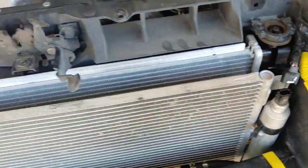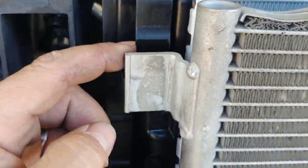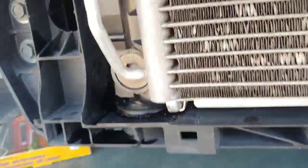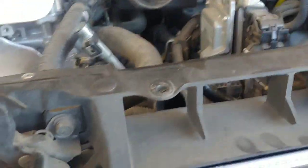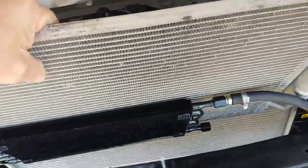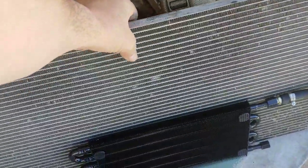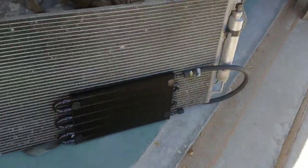If you have no more R134 in there you're good to go — just unplug your high-pressure switch. You have to push these tabs back here and here and slide the whole thing out. Slide the whole condenser up and out like that. I'm gonna take it and put it somewhere where it's not gonna get damaged. There's the condenser and the transmission oil cooler, but that's for another day.